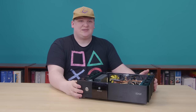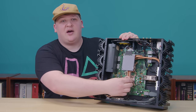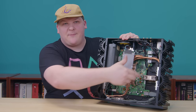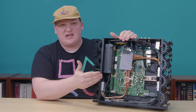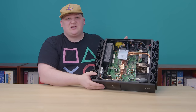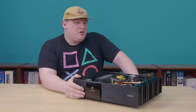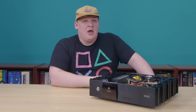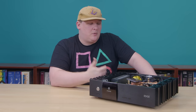That doesn't really surprise me, because from the get-go I felt that this cooling system was massively overbuilt. The thermal capacity of these copper heat risers alone probably exceeds either of the original heat sinks, and with about four feet of heat pipe stacked high, not to mention these gigantic outer aluminum sinks, this is just a tremendous amount of mass and volume dedicated to cooling two little tiny chips. That's probably why none of it really gets noticeably hot. The sinks, the pipes, the risers — they all get tangibly warm, but that's it. You can barely tell the thing is operating. I checked it with a thermal camera a few times while gaming — the hottest components were a VRM and what I think is the chipset, and neither one broke 55 Celsius. So yeah, who can complain?